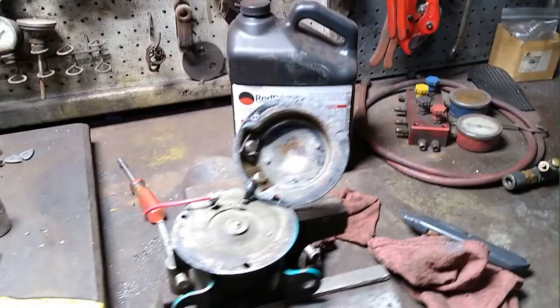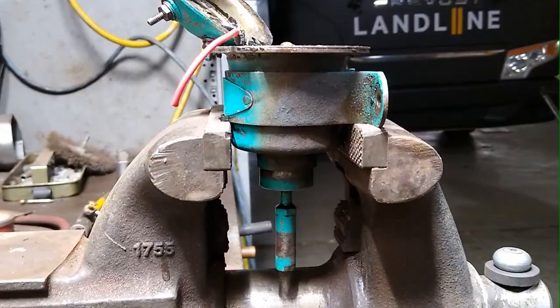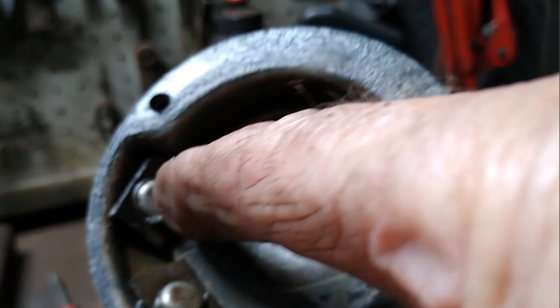The next thing that comes up in our world of electrical work is the emergency stop solenoid. The indications are that the coil is open. So when I take the back cover off of the coil, here's what I find. I find the wires twisted off. See this terminal here, and the wires are twisted off.